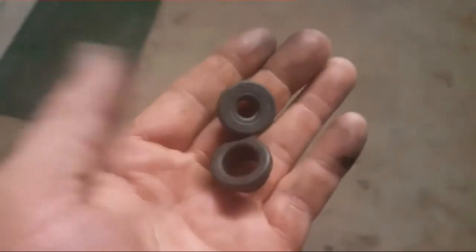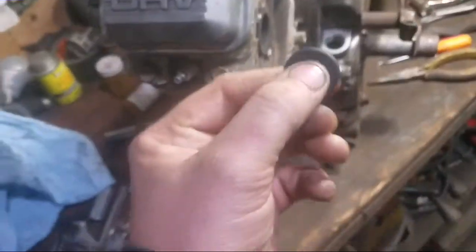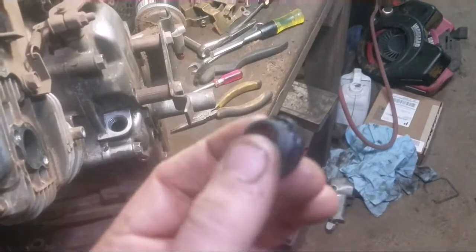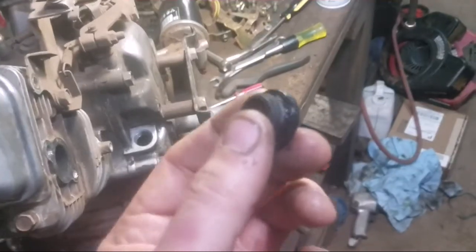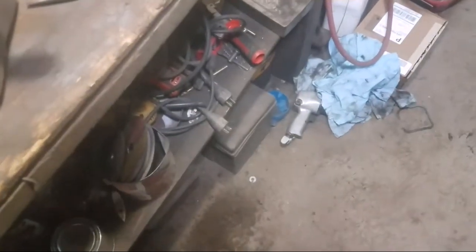And my gasket kit didn't come with the right one. It came with the newer style for like the cable dipsticks. This has the flat blade, so that won't work for me. So let me Permatex that before I stick it in, and I'll turn the camera back on. Okay, we'll see if that won't focus in on it. So yeah, that's where I put the RTV, was just on the top ring of that. I can stick that in.